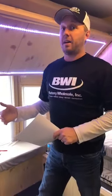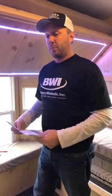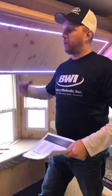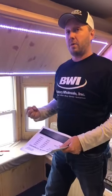That's a lot of power that these houses are pulling and using as you guys are sitting out there. So people always come to me and say, hey, I can't make it all weekend on my battery. What's going on? Well, if we look at amp hours as your fuel tank, if you have 60 amp hours and you're pulling 10 every hour. Now, don't get me wrong, that furnace, once you warm up, is not always going to sit there and pull the 5 amps.